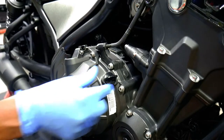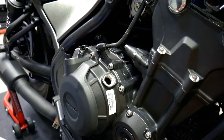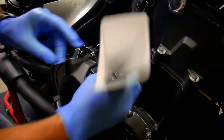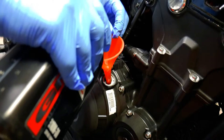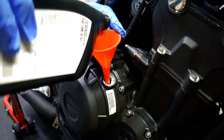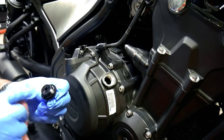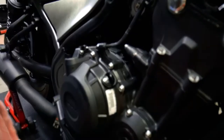Adding oil — this part's fairly simple. Here's the oil filler cap I was talking about before. I just had it loose for the time being to let the air flow; I don't like keeping it uncovered too long because you don't want any debris getting in there. It takes 2.9 quarts. I'm going to say that's about 2.9. Take your filler cap, make sure it's nice and clean, and make sure your O-ring is still there around it. And voila — oil change done.